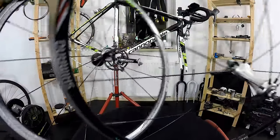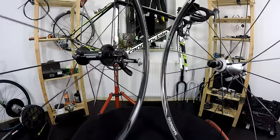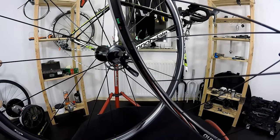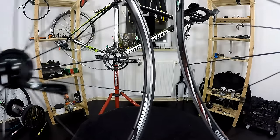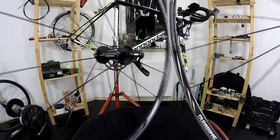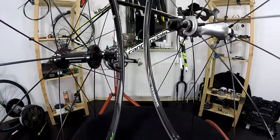So let's remove those wheels from the bike and do some measurements and more details. Here we are with the front wheel — to make it more informative I'm going to compare this one to my older Ultegra, which is also Shimano, model R601. The main difference you can see right away is the hub — especially the flanges. This one is much larger in diameter, and the nipples are assembled to the rim here, while on the RS11 the nipples are on this side of the hub. The oversize flange should allow for better stiffness, but I don't feel better stiffness on the RS11 — I do feel better stiffness on the older Ultegra.